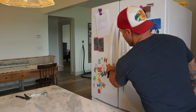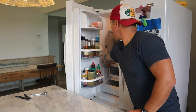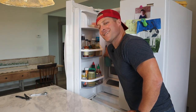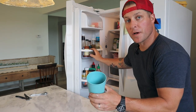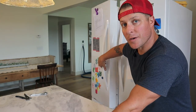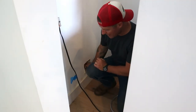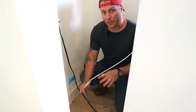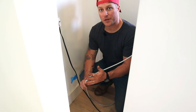Our refrigerator has water on the inside of the door — it has an ice maker and a water dispenser system. Let's see if it works. All right, we got water! Flow two full cups out of the refrigerator to get all the air bubbles out of the line. Now we go to the back side again and check for leaks — both fittings seem to be great, no leaks at all. I can hear the refrigerator pulling water in already. The last thing is to run this water line the best way we can to make sure it's straight and will not kink or get run over when you push the refrigerator back.